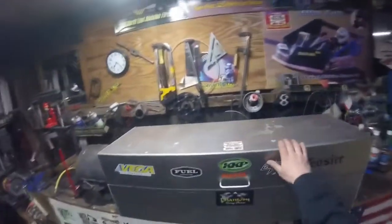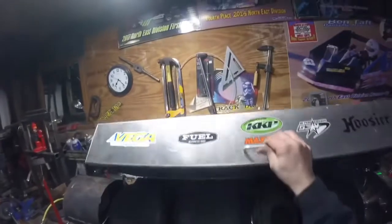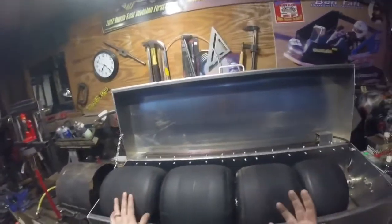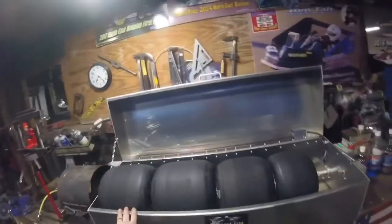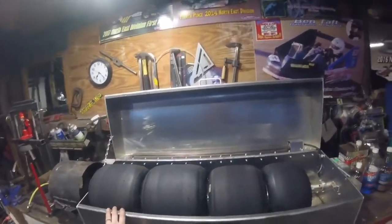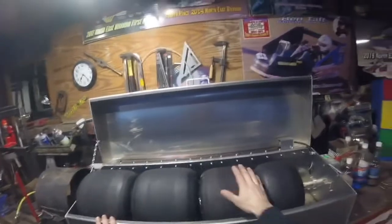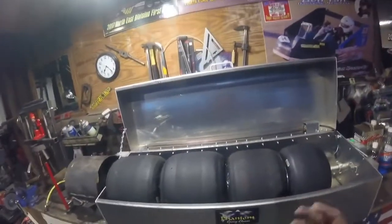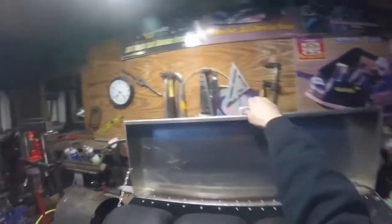This is my hot box — another KKP product from JC Specialties in PA. Absolutely wonderful, so warm. Right now I'm running about 90 degrees; I'm trying to pull prep up through the tread. For my prep application: I use a piece of fuel line and a cup, measure it out, compress the tire without the valve stem in, put the fuel line on, suck the prep from the cup into the tire interior, put the valve stem back in, blow it up a little, then into the hot box or tire roller. Nothing crazy — I've never needed an injector.